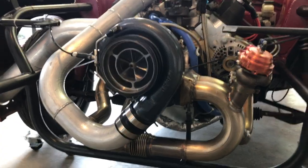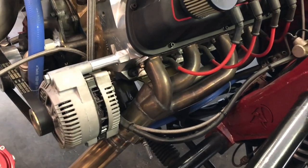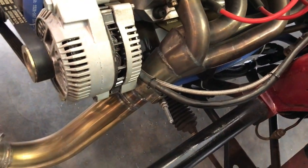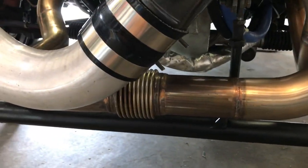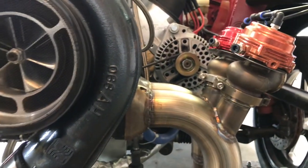Hopefully he's broken the curse and will just continue to get quicker and quicker. Anywho, here's what we got going on. I reused my same shorty headers — these are Pypes brand headers, real stainless, not chrome. They're pretty decent for the money. They've been modified to choke down to a two-and-a-half inch v-band. This bank just curls up, and this bank over here has a little snake — it loops around with a flex. It's a good idea to always put a flex in at least one side so if you get vibrations or swelling you don't crack a weld. Then it loops around up here, and I've got a brace that I welded to the flange down to the tube front — it's removable, just to keep it from bouncing.